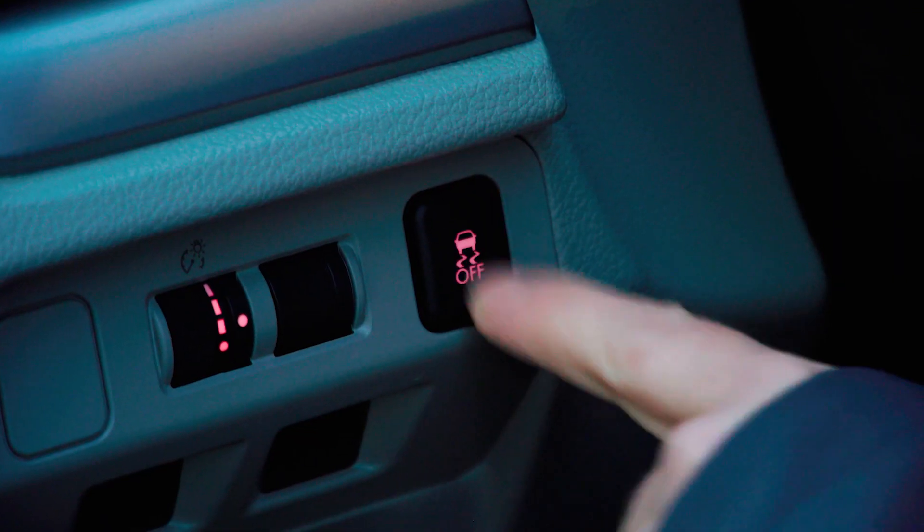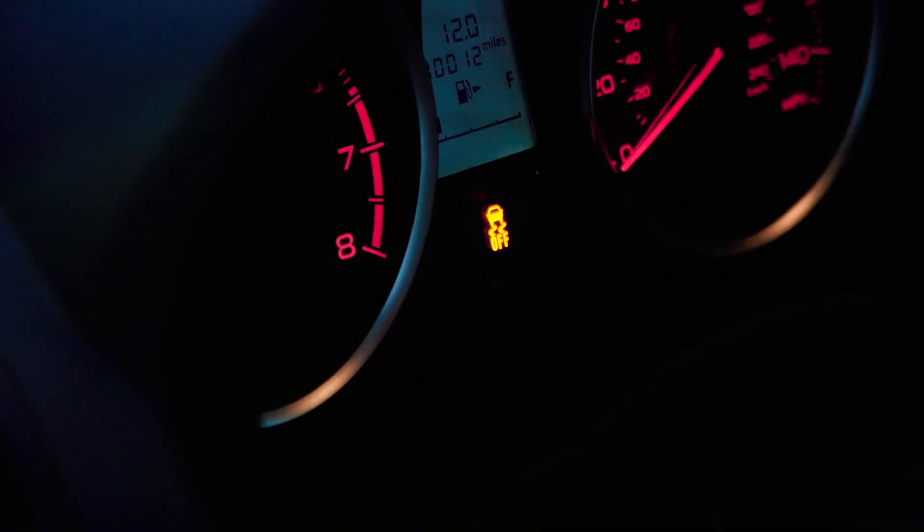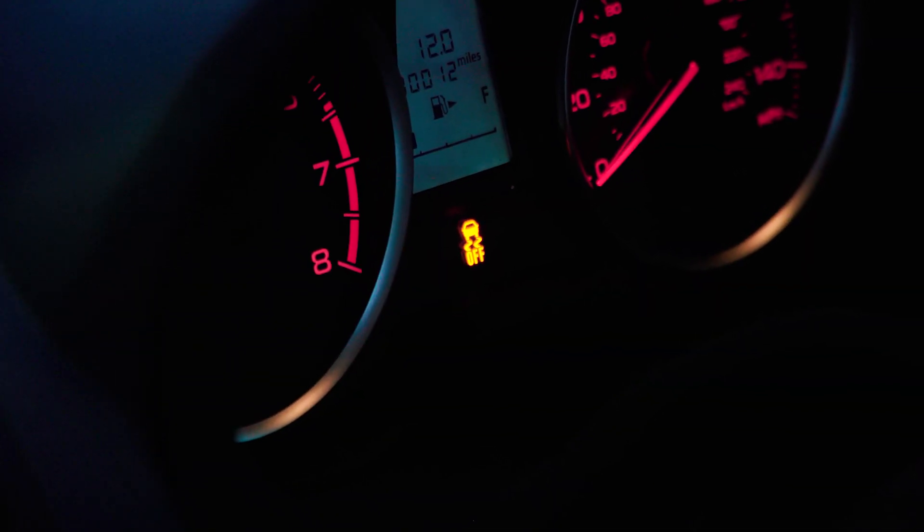However, we have an off button, and the off button's there for a very good reason. The system operates by cutting power, so if you were to get yourself in a situation where all four wheels were slipping, it would cut power to all four wheels, and then you're not going to move. If you manage to get in such a position, maybe on an icy hill or you slid off the driveway, turning the system off allows those wheels to spin freely, building the momentum to get out of that ditch or up that hill without having the power cut to your wheels.